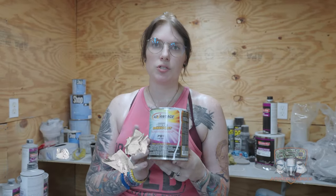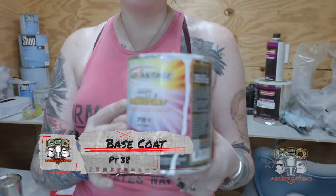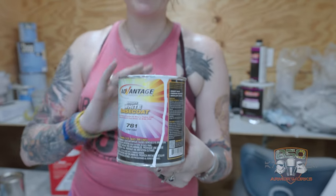After we make sure all the pieces look good, lightly sanded, everything smooth, then we go on to the base coat. Again, more automotive paint. You only need one coat. You don't need to go all trigger happy with it. One coat will be just fine. Yes, it may not look like it's covered enough, but this base coat gives the single stage a much better grip.